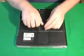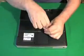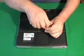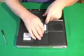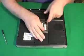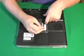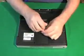Like the CD drive. And here I'm getting to the RAM — there's one stick in there. You just grab the two ends of the RAM holder and it'll pop up. Sometimes you have to use a device to get in there if it's too tight, and then you pull the stick of RAM out.